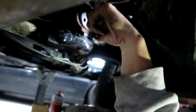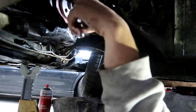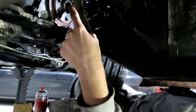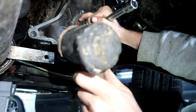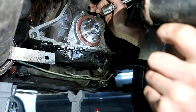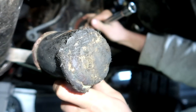We'll take that sharp edge off and hopefully tap the spigot in. The outside is a bit ragged but tidy that bit up and the rest is actually not too bad. After a little bit of die grinding it looks like the spigot might be able to go in now. Not ideal conditions but it's what we've got to work with.